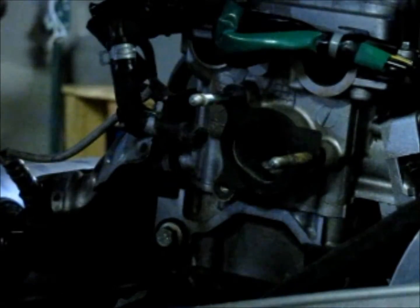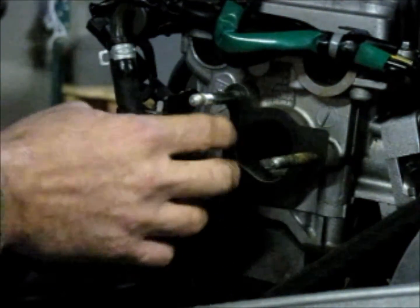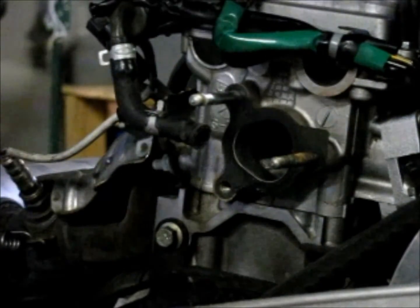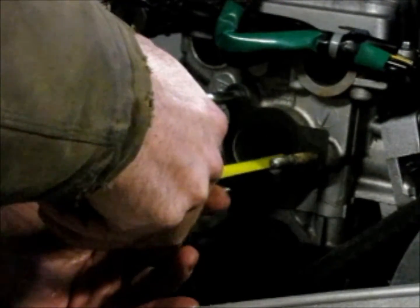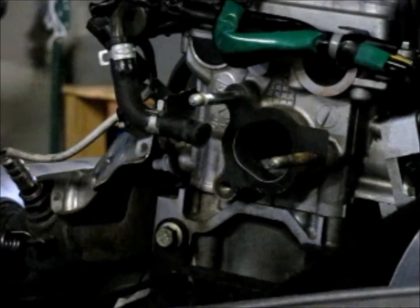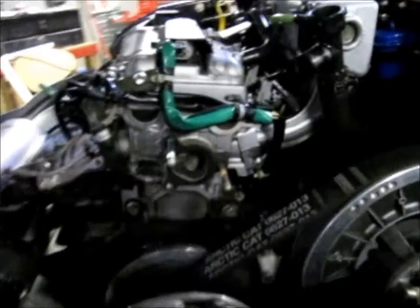So that part's going with me — the thermostat and this other housing. It looks like this gasket is still good here. I've got depth here and I'm going to go ahead and measure that just to be sure — I'm going to say an inch, got a full inch there. Now I'll take that up with me to the parts store and we'll make sure we get the right one.